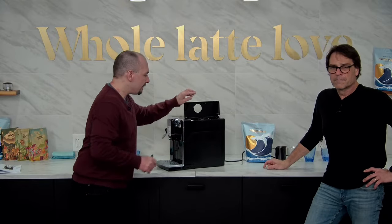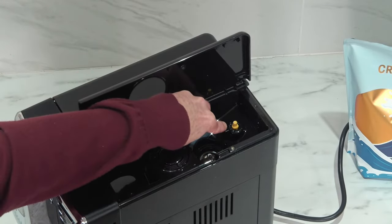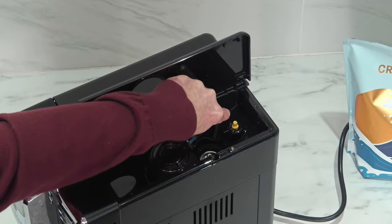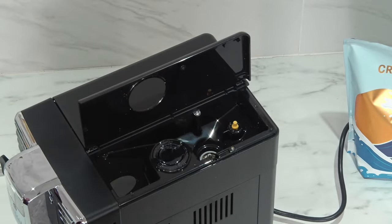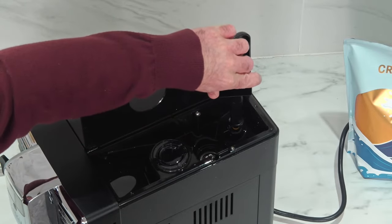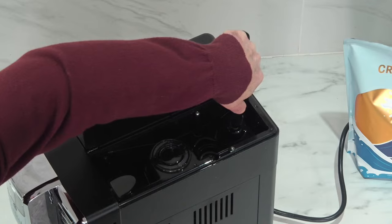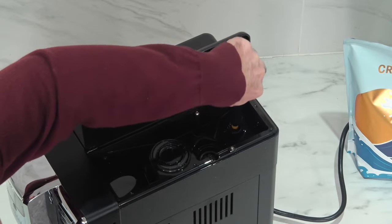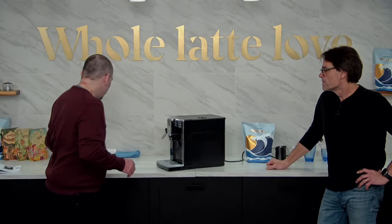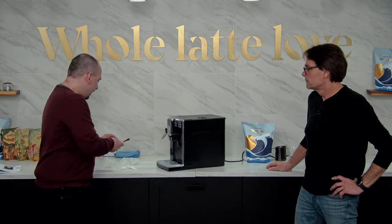And then right in the top, inside our bean hopper here, there's that yellow post that sticks up. And there's a little tab that indicates which setting we're on. There are five little dots there. We're just gonna wanna insert our key in. It's a hexagon, and then it twists kind of like a medicine bottle. So you go down, and we're gonna turn it as far as it goes, counterclockwise to that finest grind setting. That's going to ensure stronger coffee off the bat, and then it's very easy to just ease back that grind.